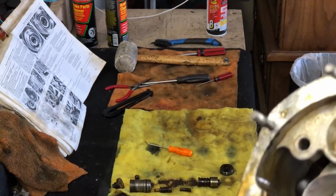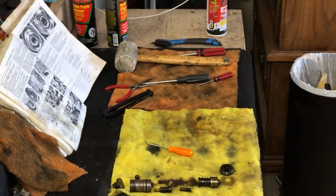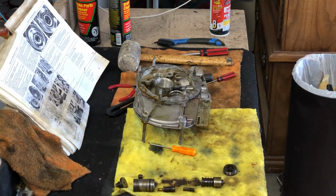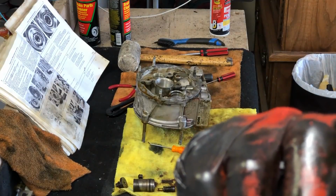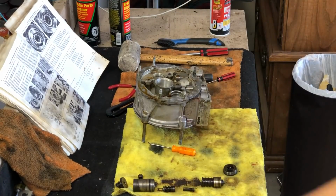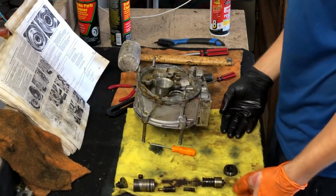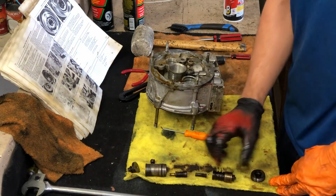If you don't have the Overdrive apart, you're just under the car, you can pull this access cover off. But getting something in there is a real pain. You would want something like a 90 degree pick, but it needs to be half as long, so I'd have to cut it, and then you could hook it in there and start to pull down. I think tapping helps and getting it to spin helps. All these little things help versus if it were just stuck and I was yanking on it. So that's all the components of the relief valve.